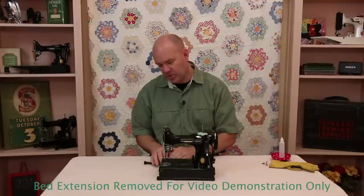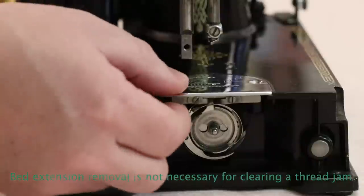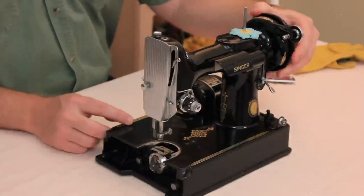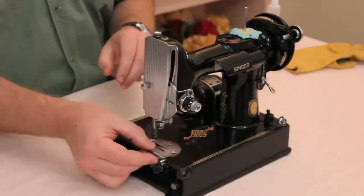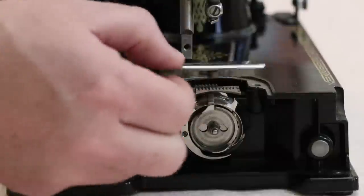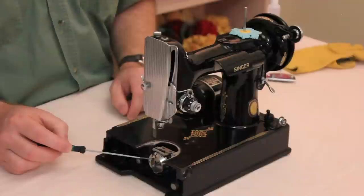I've taken the bed extension off, the foot off, and the needle out. The next thing you need to do is take the needle plate off — it's held on by just two screws, which I've already removed. Now, often when you take the needle plate off the machine will turn freely, and you might think the thread jam is gone. But the issue is that when you put the needle plate back on and the positioning finger is in the slot, you've locked the machine up again. The problem is thread caught between the hook assembly and the bobbin case base, from turning the hand wheel the wrong direction or letting thread tails get pulled back in there.